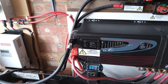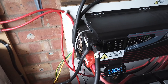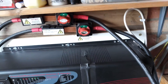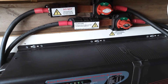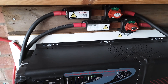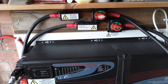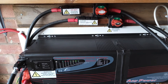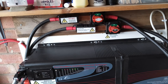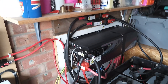I don't know whether I showed you this bit — I upgraded so that when charging the car I put two cables coming from the inverter side, both on the positive and negative, and also the same on the positive side, taking through two of these isolators and fuses. Those with a keen eye will spot there's a potential flaw: if one fuse blows, you're still restricted to just one strand. But it does spread the load more evenly and I haven't had any issues at all — the draw is not going to be anywhere near 250 amps anyway.